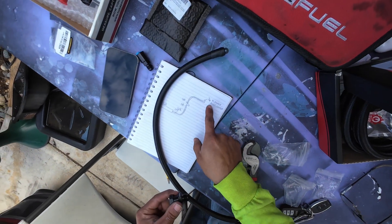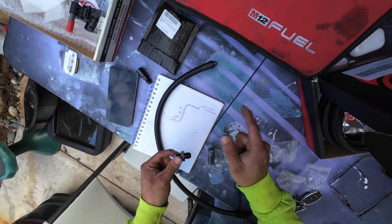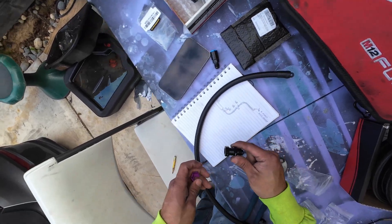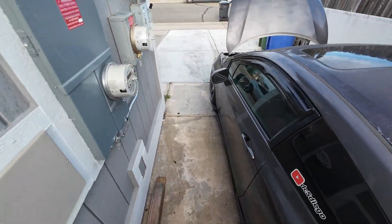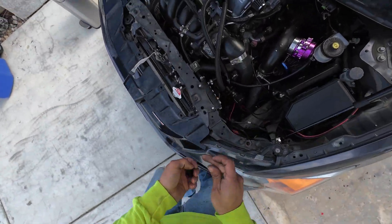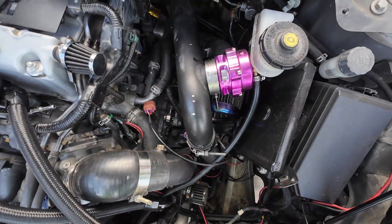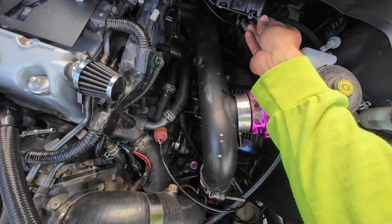Just squeeze this as far as you can get. I'm actually going to start from the quarter-inch one — this one's at the way back toward the back of the engine. I'm actually going to start threading on this K motor fitting and start from there and work my way toward the fuel rail. So that would be this one right here — I hope you guys can see that.